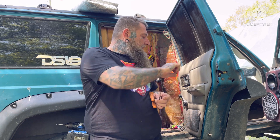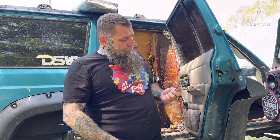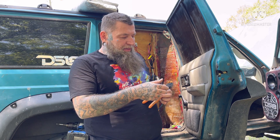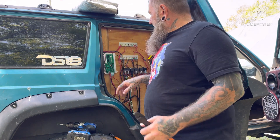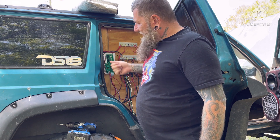This is a good old 10-gauge field wire that runs up to the front to the alternators. Talked to Joshua and told him what size wires I had on everything, and he told me that would definitely suffice. I got this from DC Wire and Supply — they sell welding wire and everything. It's a good old OFC 10-gauge, should be perfectly fine. Got crimp connectors on there, and the reason I have to use them is the fields have that spade terminal — female to plug on.